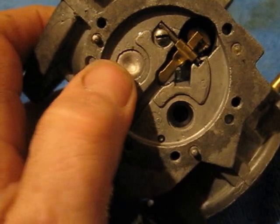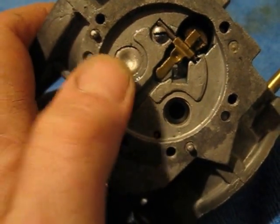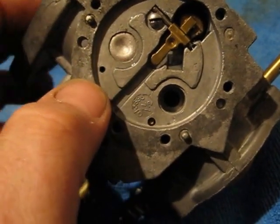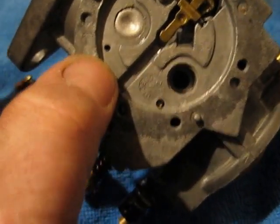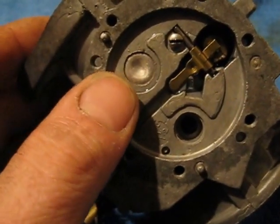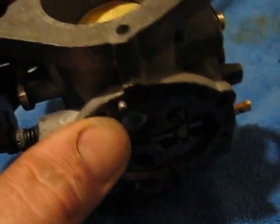To access that you have to drill out that Welch plug, pry it out, and drive it out with a 3/16 inch screwdriver bit or maybe a quarter inch socket — something along those lines. Then replace it or clean it and you should be good to go.